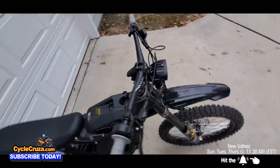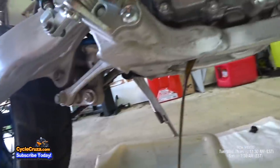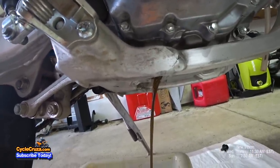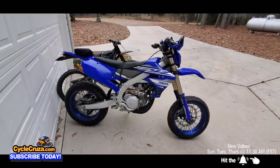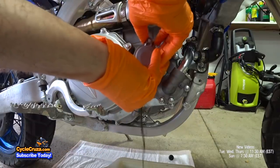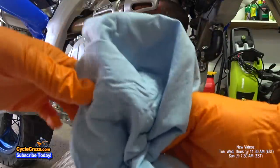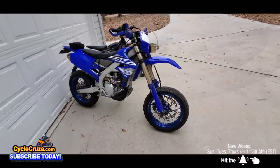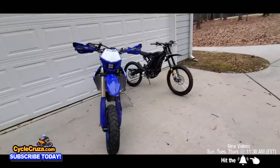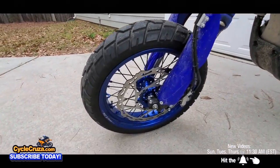This bike is super cheap to own overall — the best bang for your buck, especially compared to the YZ. The big con to my YZ Supermoto is that it requires a lot of maintenance. I have to do oil changes every 12 hours because it only has a little over a quarter quart of oil in it. You're supposed to do valve checks and top-end rebuilds every 12 hours according to the manual — though I have nearly 100 hours and haven't done one rebuild, and the bike rides better than new. But I still have to do lots of oil changes and buy gas, whereas the Surron I charge for free with solar and there's no maintenance except changing the brake pads.